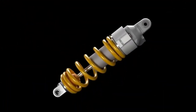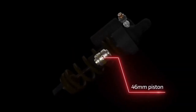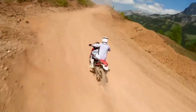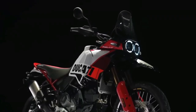Like the regular Desert X, the Ducati Desert X Rally has an aluminum swingarm, but the pivot point sits in a different spot. A fully adjustable KYB shock features a bigger piston than the base model's unit. With the suspension changes, the Desert X Rally's ground clearance now sits at 280 millimeters.